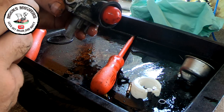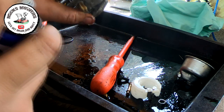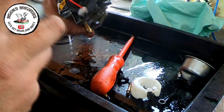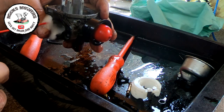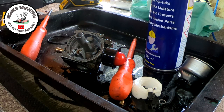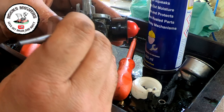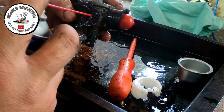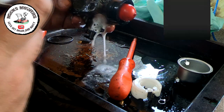Clean that one out. I can get into there - I'll only put a little bit in there. Turn it around, we've got one there to do. That's actually got gasket cleaner in there - I'm going to feel if it's running. There's actually gasket cleaner in that jet - that's not going to run, it's never going to run. So I want to get a dental pick first. There's some stuff in there, I know there is because I felt it. Now I can see the jet - it's running out the back of the carb. That wasn't running a minute ago. That's the slow idle - that's running out the top as it should do.